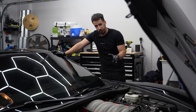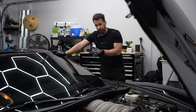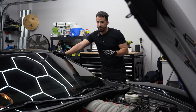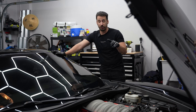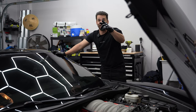Tomorrow this vehicle is actually going on a dyno to get tuned and figure out exactly how it's running, and get it even closer prepped for the track. But before I do that, I want to try to eliminate that check engine code. I've already changed the plug wires — the car did eliminate the code for some time — but now it's back, so we're going to go ahead and actually commit to changing the spark plugs as well.